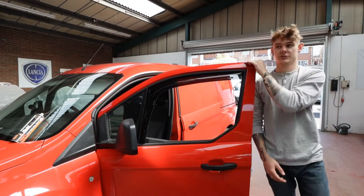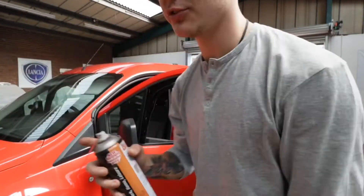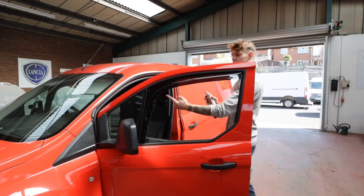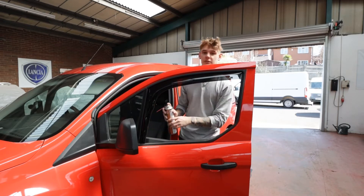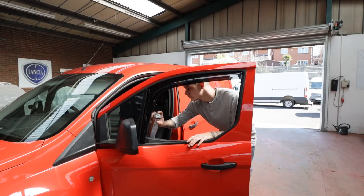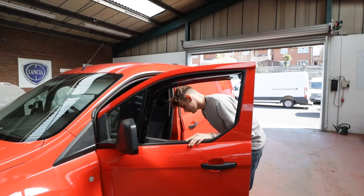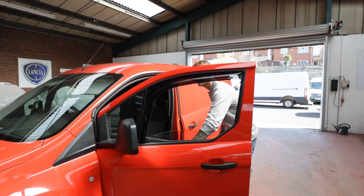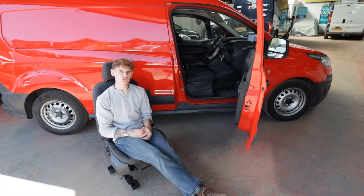All I've done on the other side is use some oil — it's like WD-40 sort of stuff, just with a thin nozzle. I'm just going to go on the gap on the inside here where the window runs against the plastic, because it's not used to it, obviously. Just going to do that to loosen it up. That does go up a lot quicker now. If anything, I lost the nozzle down my door. Job number two.